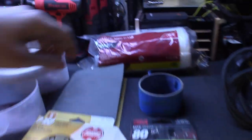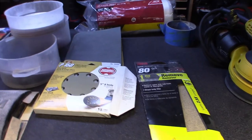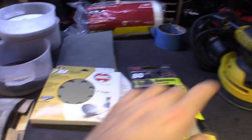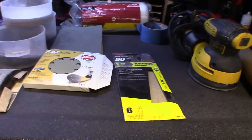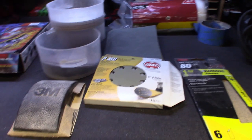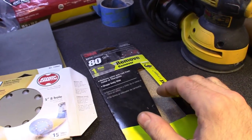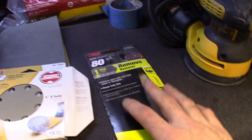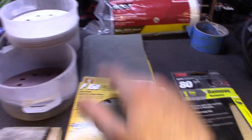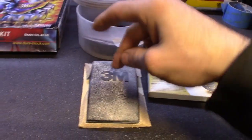For the spray booth I picked up plastic drop cloth from Ace Hardware — item number 143-1683, the biggest one they had. Used about four or five of those. For sandpaper, I used all different grits — hook-and-loop circle ones for the DA. Started with 36 grit to knock down the rough edges after body filler, mostly on the passenger side. Then 40 and 60 to take off all the old paint, finishing up with 80, 120, and 150. Then 400 and 1000 grit for the final wet sanding, mostly done by hand.